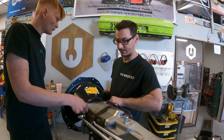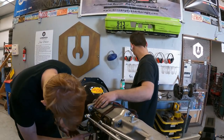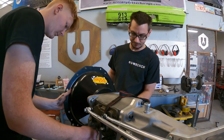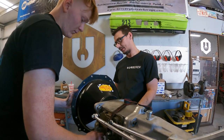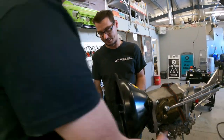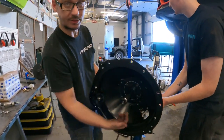On every try we've done with this thing it's been fruitless, so now we're doing kind of last resort: putting the bell housing on, taking the clutch off, putting the twin disc and everything on the bell housing, putting the transmission in, bolting the bell housing down, and then going through this hole to tighten the clutch down.